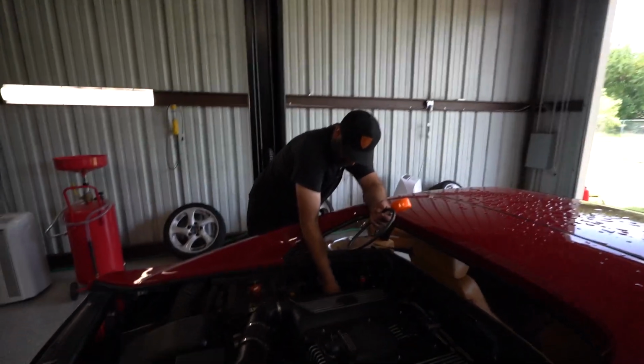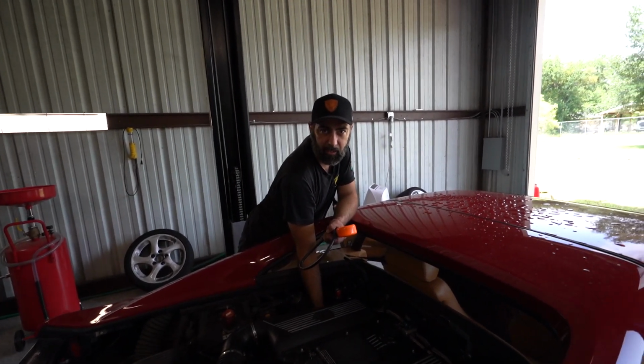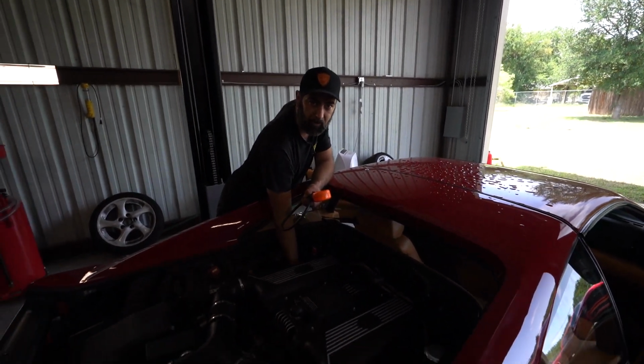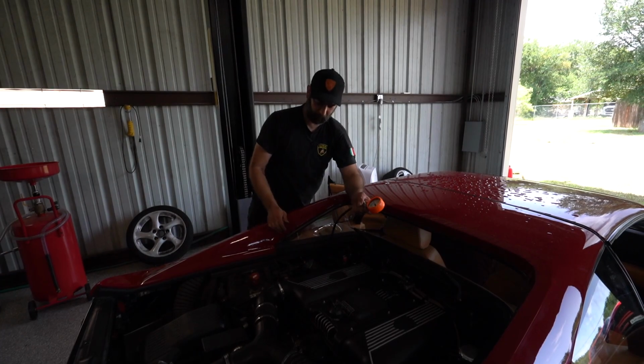Okay, so as of right now, we've got 145 and 150 PSI compression on cylinders 1 and 2. We've got 170-ish on 3 and 4, which is kind of acceptable. We got 165 on 5, which we'll consider acceptable. And now we got 200 on cylinder 6, which we already know from our experience means valve guides are definitely worn and there's definitely been excessive oil leakage and those rings are extra wet and extra sealed. That is an excessive amount of compression, especially compared to every other cylinder so far.